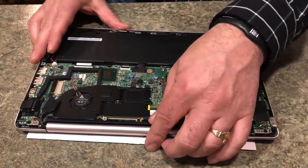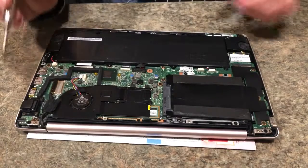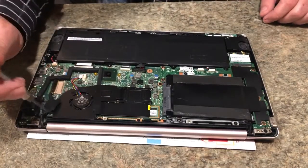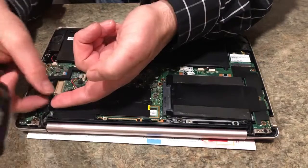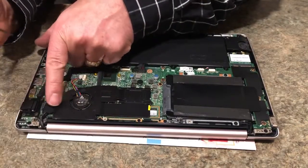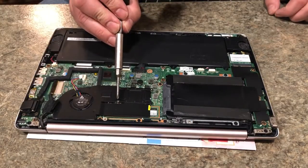So this is your CPU cooling fan. I'll show you where the screws are — I already moved a couple of them. I'm going to make the video short for you guys. This sticker here that's holding this cable down, move that back and there's a screw that you're going to remove from there.